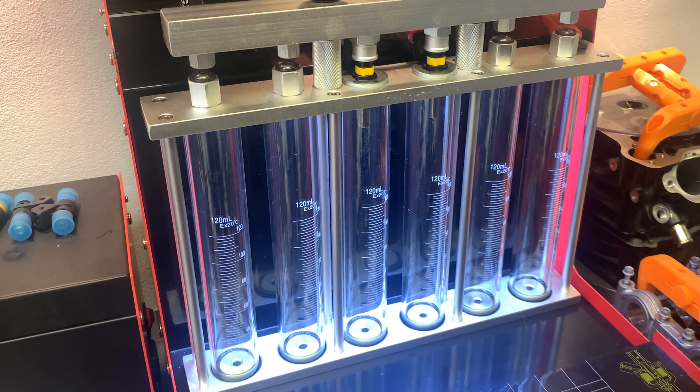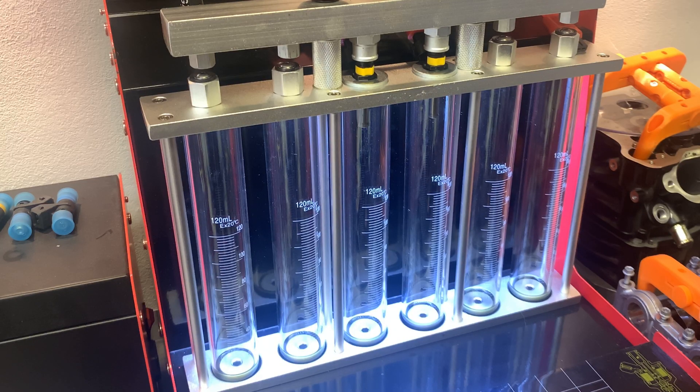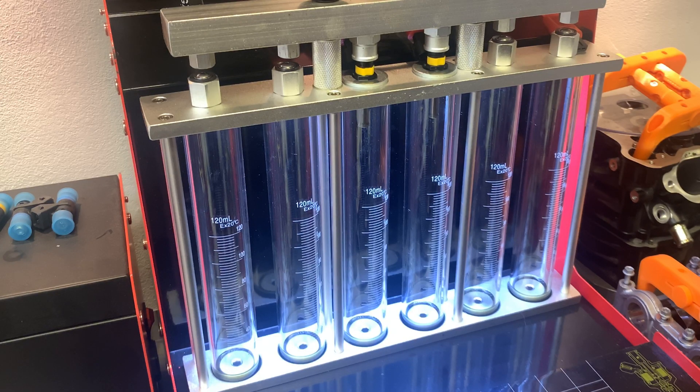This is a really rare failure — we had it before, but not on a low-mileage bike. This bike has around 20,000 kilometers and is otherwise in top condition. The question is whether a damaged voltage regulator could be the cause, since the voltage regulator was also broken. Maybe there was some overvoltage — I'm not an injector specialist on how the little spool inside can get damaged. But the left injector is clearly not reacting on small impulses; it only opens when the number of impulses rises high enough.